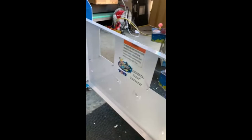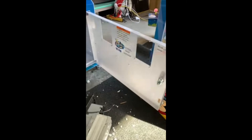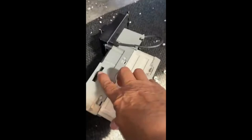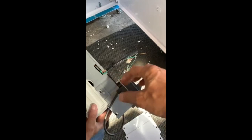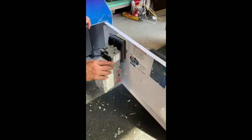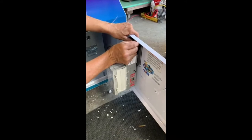We're going to hold on to those nuts that we pulled out — now two empty holes. Now we're going to take the dollar bill acceptor; you can see the studs are still there. We have this wire harness that's going to go for the DBAs, and that gets plugged right up into here. Now that we've inserted the wire harness for the DBA — it's got plastic tabs so it can only go in one way — it goes in the top here. That sits on those studs and we're just going to tighten those nuts so the dollar bill acceptor is securely in place.